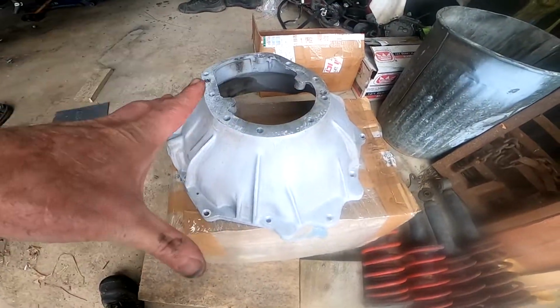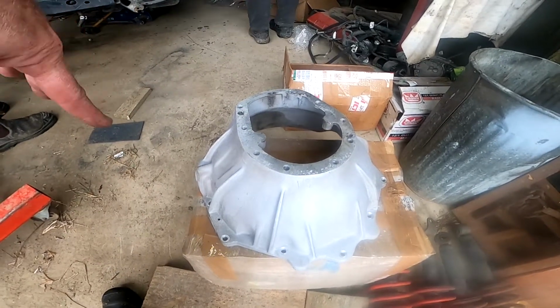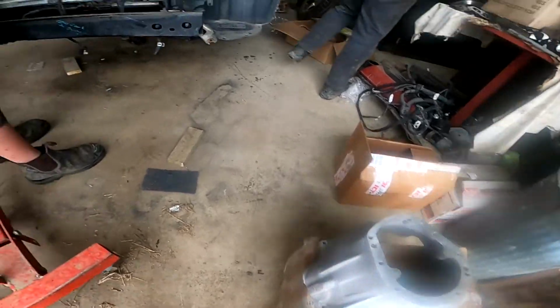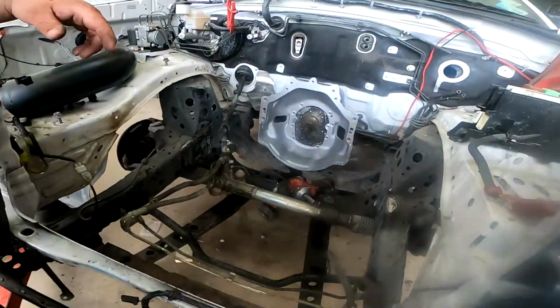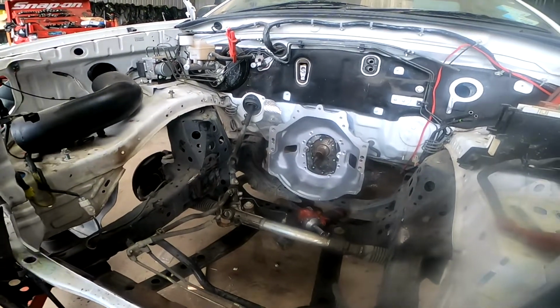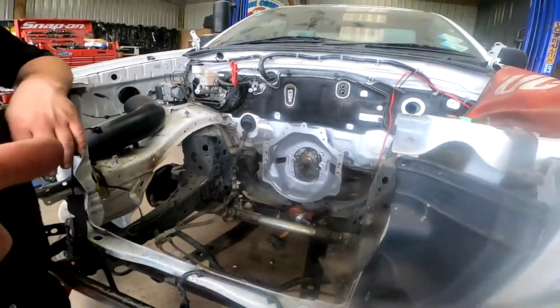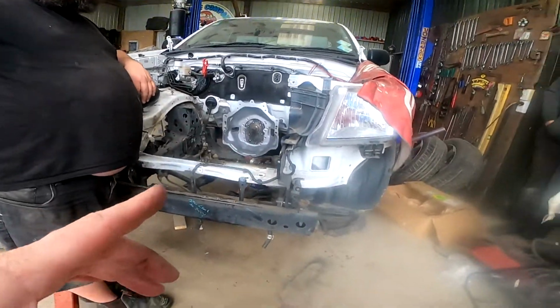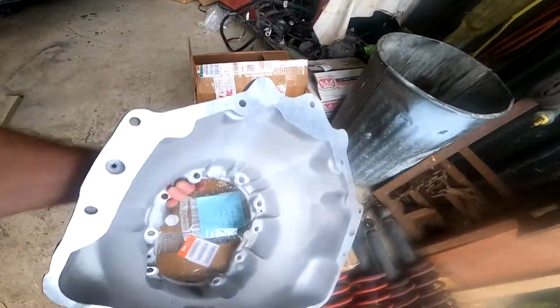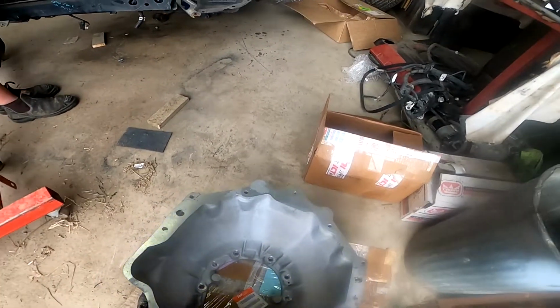Alright, back to work. So this is the bell housing we would normally use, but there's a bit of an issue at present with the suppliers there. The man's getting old and retiring, and this is a possible replacement. That is massive. Yeah. Absolutely massive. So that one will take the big flywheel without a problem, eh? This one we'd normally have to take a bit of meat out here to fit the big flywheel, and I think, have you got the torque converter? Or the flexi plate?